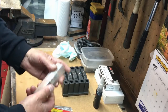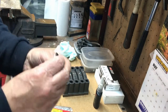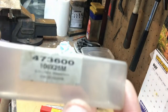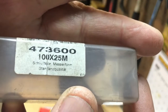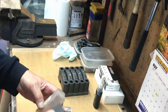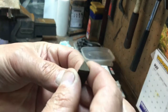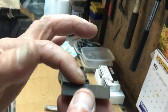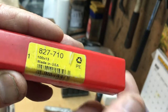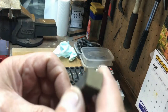Here at the bench: stoning is all about using a stone. My stones are pretty knackered and broken. This one was 100mm long originally. The RS number is 473600 — 100 by 25mm. It's got a wide face, good for general use. I've also got a triangular section one, RS number 827710, 100 by 13mm — a bit coarser but good for getting into internal corners.